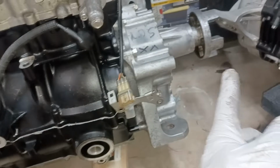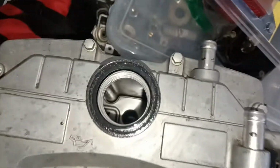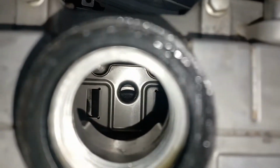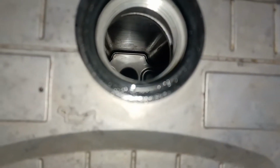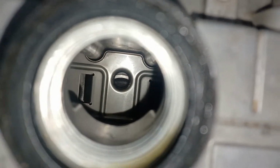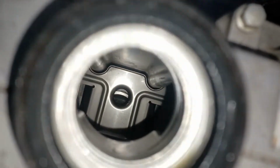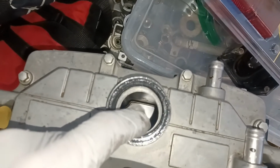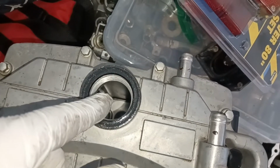When you do the oil change, you're only siphoning oil pretty much from this first level. So you see that plate down in there? That plate is right about here, and there is more oil below it. So ideally, you try to feed your straw right down that middle hole there, and you can reach the bottom. It's not easy to get it down into there, but you can, and that'll siphon out the majority of your oil reservoir. But a lot of times that bottom oil is left in there, so your clean oil is mixing with that a little bit,